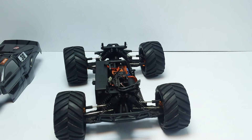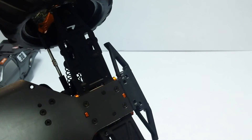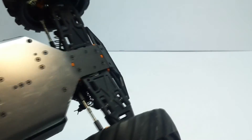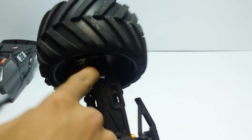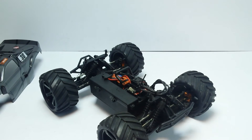Common parts like the shock positioning screws, bumper, and underside screws are all self-tapping — a terrible idea, especially for parts like A-arms that you need to keep disassembling. You can't keep doing that without wearing out the holes. You can actually see this wheel wobbling because a screw fell out, which is a common issue on this car. Even with stock screws they just seem to get lost, even with thread-lock applied.